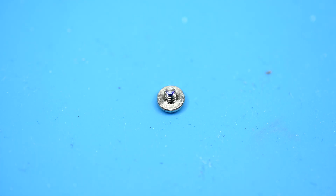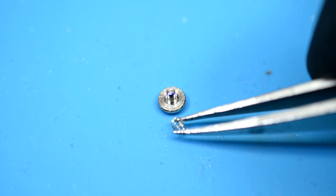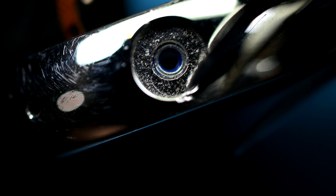The button itself is spring-loaded, but the spring is free and can easily fly off — you do not want to lose this. Just like I thought, this drop or bash knocked just enough of the frame to bend the circular hole for the button. This puts friction on the button, keeping it depressed. That's not a problem — I have a Dremel tool that will cheer it right up.